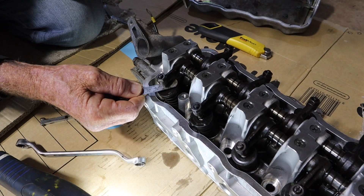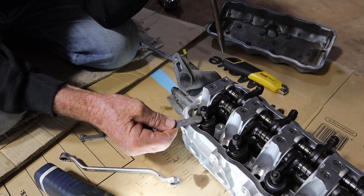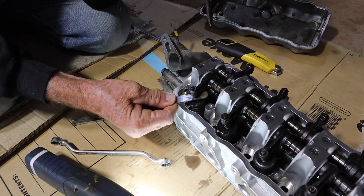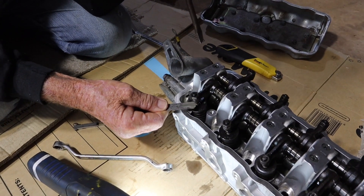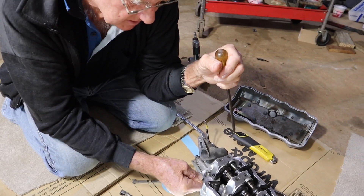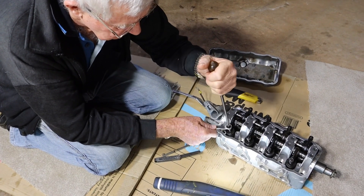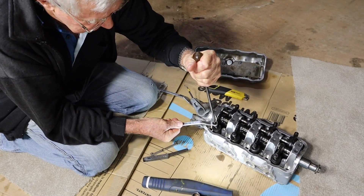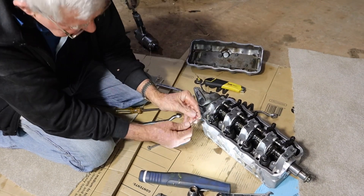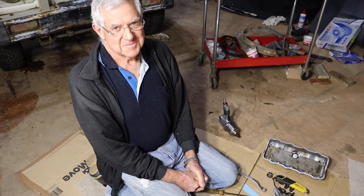So it's done, and I can move that just slightly easier. If you can't put the feeler gauge back through, you've got it too tight. You'll see it's a bit firm but I can still put the feeler gauge through. There we go — still push the feeler gauge through. If you can get it like that, that's probably as good as you're going to get. Sometimes you can cheat — just tighten this up a whisker more and that will just pull that screw and thread slightly. That'll do. Another job done on the Suzuki 1 litre Stockman — thanks for watching.